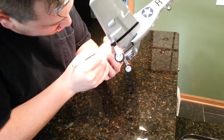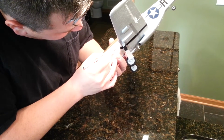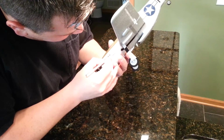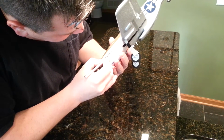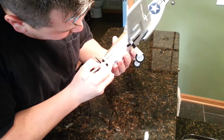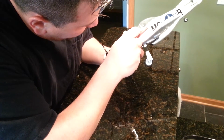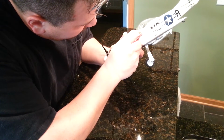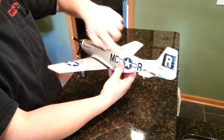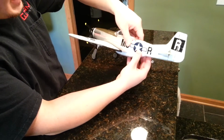Same thing here, you're just going to find that line and verify it before you get into the cutting part. Sometimes it's a little easier to start the cut halfway through the decal, because if you try to do it right at the tip of the decal, or the edge of the decal where it really originates, then what will happen is you'll just seal that down into the crack. Okay, so that should do it for that seam. Obviously we'll potentially have to carry it around all the way over on the other side, but let's just see if it breaks free yet.